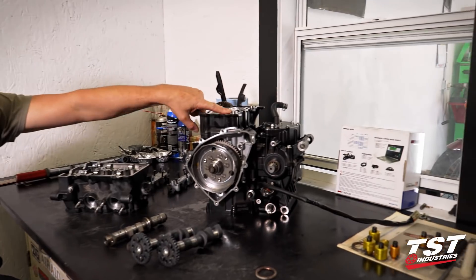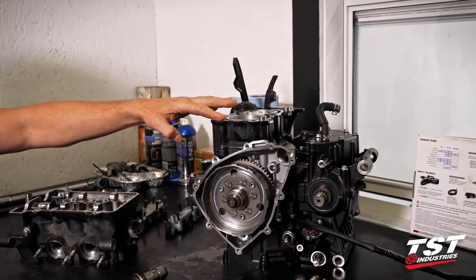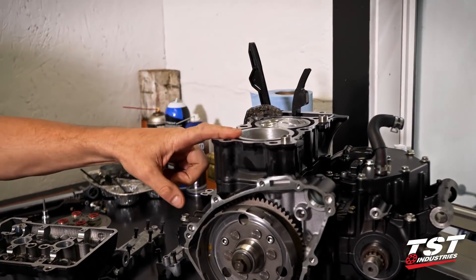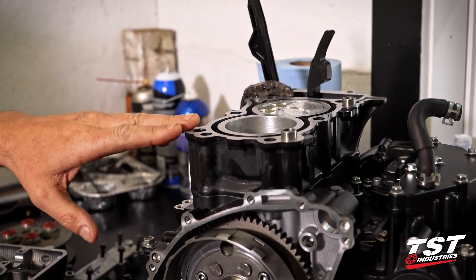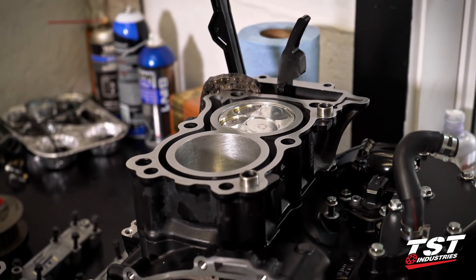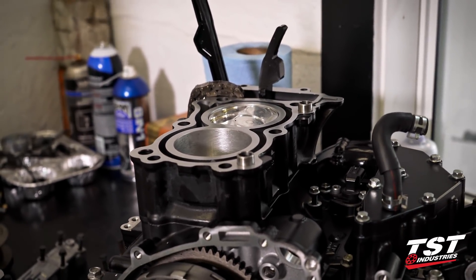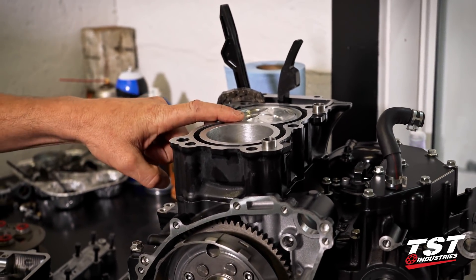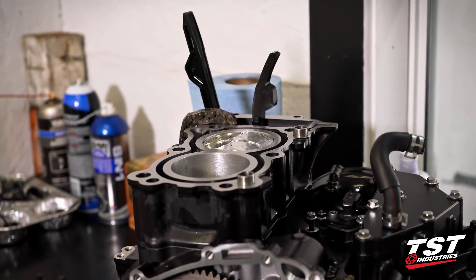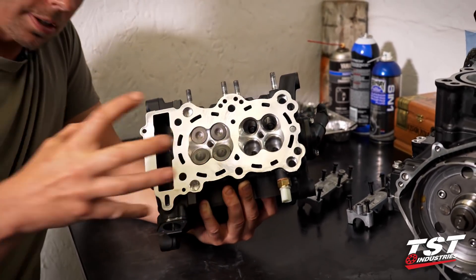Now while you're looking at the engine, you'll notice the cylinder head goes right here. But underneath you've got a set of cylinders. On the cylinders we have a machined surface — it's nice to do what I like to call a scratch test and make sure the cylinders are going to be flat. And look at this — see that thing sticking up? In the last episode we showed you a piston. You'll notice there's a dome sticking out of there, and I don't call that little — in my mind, that's a lot. It looks like a motocross piston. But what that piston is going to do, with that dome and all those angled valve cuts, is make us some serious compression in this combustion chamber. That dome is going to fit up in this combustion chamber, and that's going to make us a tighter compression ratio and a lot more horsepower — we hope. That's the plan.